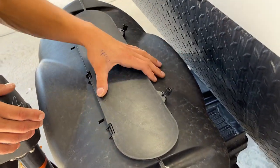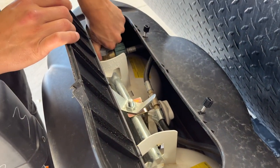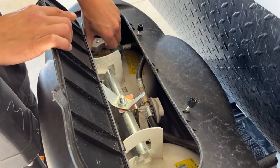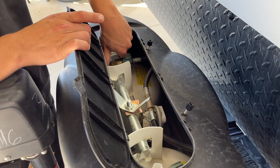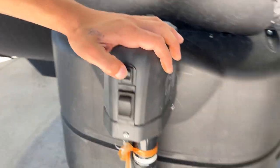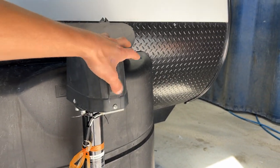At the propane cover, loosen off those knobs, push them back, and open the flap. Inside you'll find your propane valves — just turn those to open them up. They're teed into the same regulator, so you run off one tank until things stop working, then close that one and start running off the other while you get the first filled. Out front you get a power tongue jack with a little light switch up top; up is up and down is down.